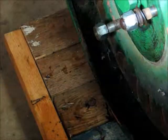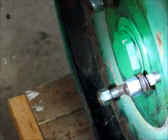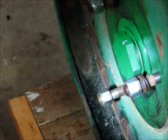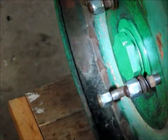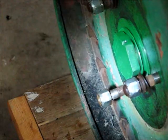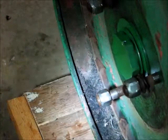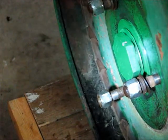The one thing that I'm finding though is with a lot of the bolts, let me show you that, the actual stud comes out, but the actual nut is not moving at all. So I'm hoping I can remove the nuts and reuse the studs, because all in all the studs look good. They're not bad at all. They can be reused, but it's just the fact that they come out easier than the rusted solid nut. Out of these three, only the bottom one there is actually where I removed the nut. The other ones, the studs basically came out.